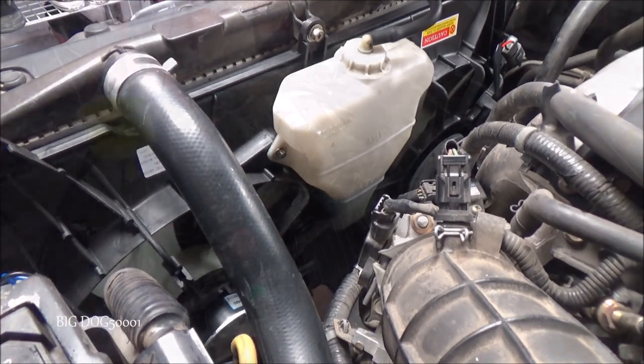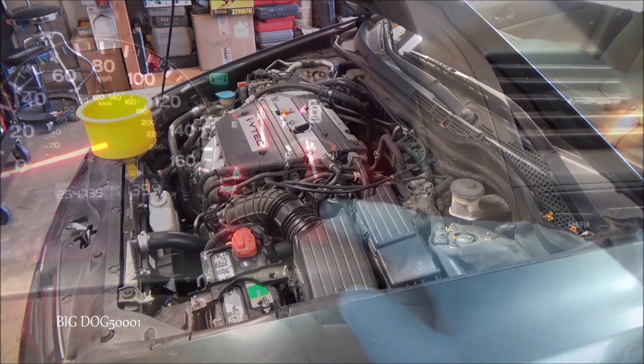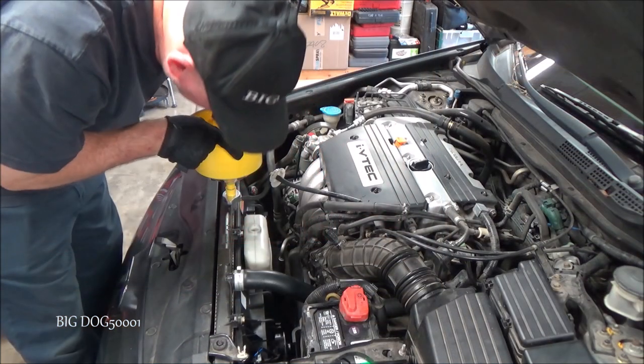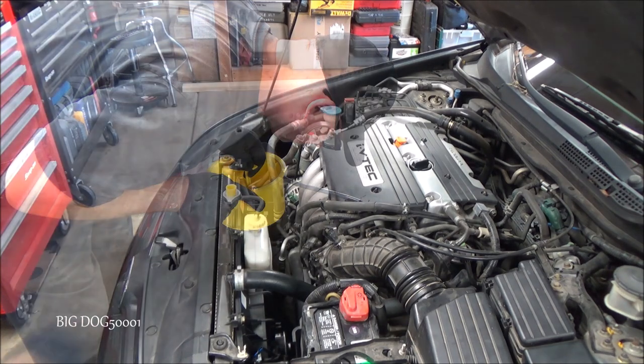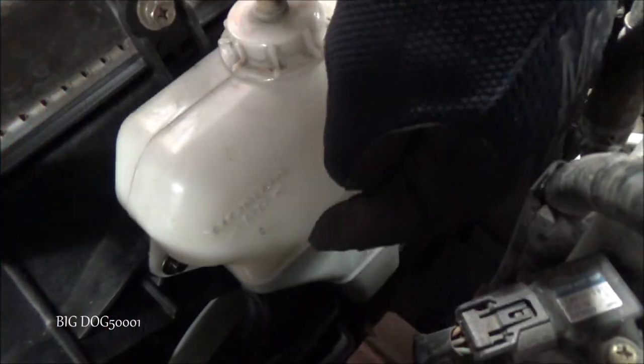They're definitely working properly. It looks like our ECT, our thermostat, our switch, and our fans are all working perfectly. If we look at the temperature gauge, it's a little bit below halfway — that's exactly where we should be on a properly operating Honda system. We always want to top the reservoir off to the max line whenever we service the coolant, and of course check underneath for leaks. That's it for this one — confirmed fix. Once it cools off I'll hose off the engine compartment where we made a mess, then she's ready to go back to the owner. If the video helped you out, give it a thumbs up. Thanks for watching.